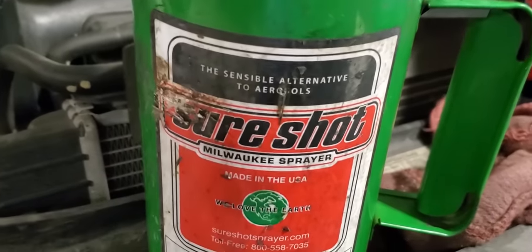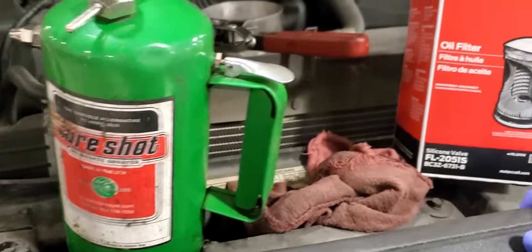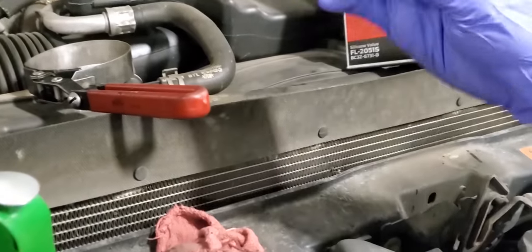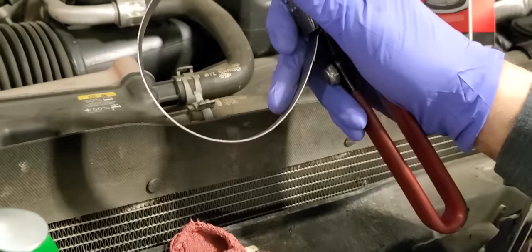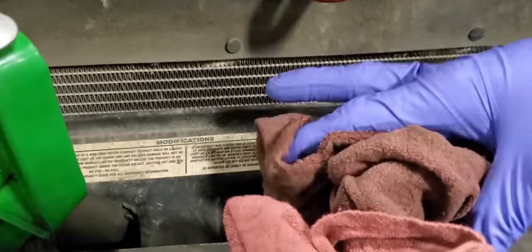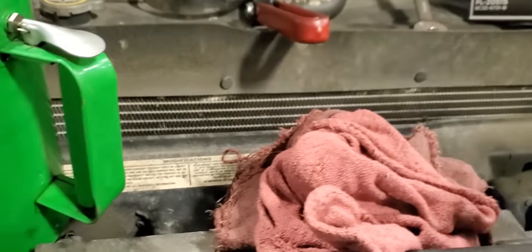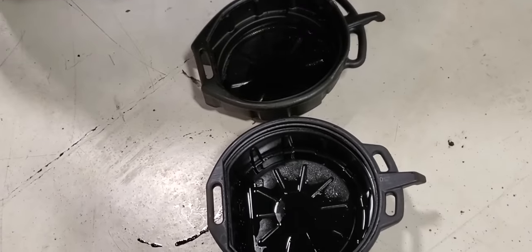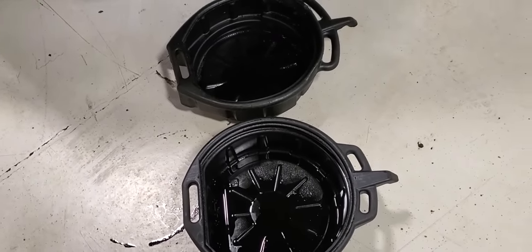One of the crucial things you're going to need is a few cans of brake clean, because you'll definitely need it. Get a Motorcraft oil filter, you're going to need a 16mm wrench, and a suitable oil filter strap that will go around that FL-2051. Get some rags, get them primed and ready for the job. Also get two drain pans — I like one for the filter and one for the oil.